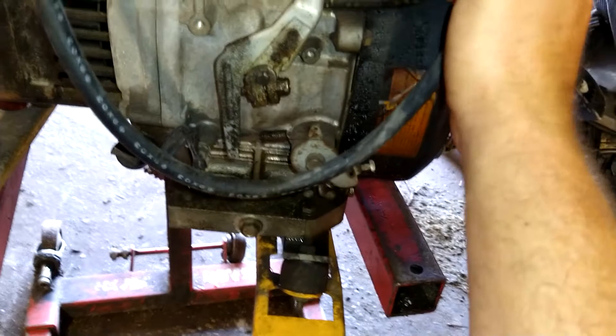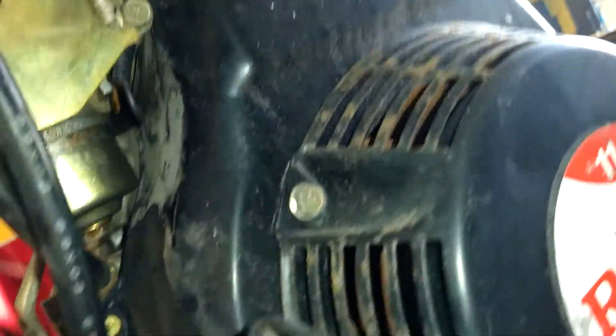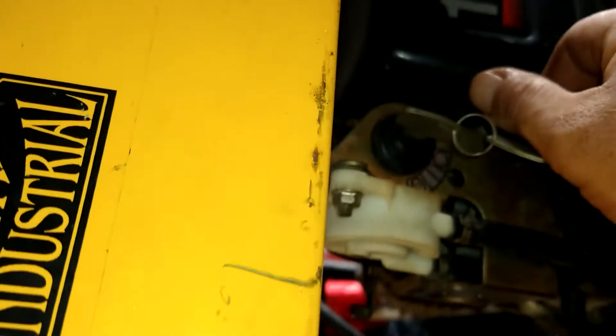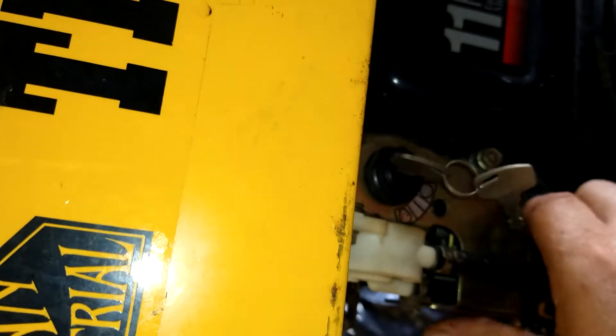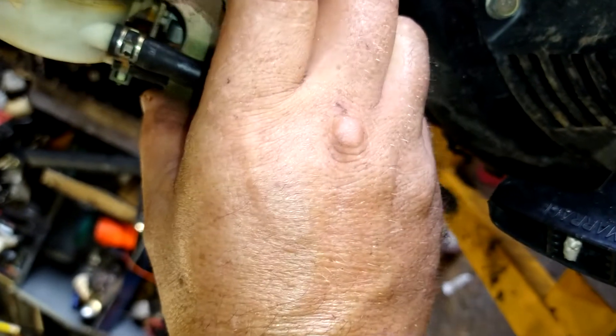This should be going all the way back but it's hitting something. There was an extra 10 millimeter bolt that I didn't even know was back here. We're going to loosen this guy up. There's a 10 millimeter bolt — and it's got a ground wire on it. There's a ground wire on it. Get it in place — it must have been loose.